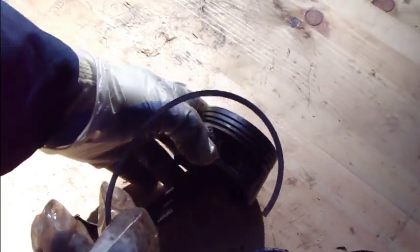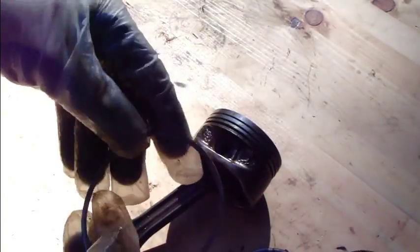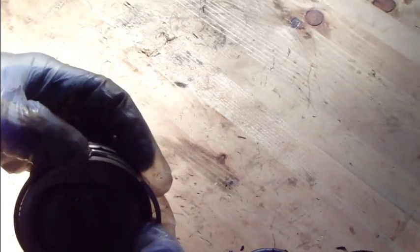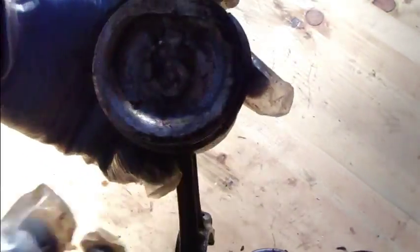In this Volkswagen, it's interesting that the first ring can flex somewhat, but if the piston ring gets into that kind of situation where we have bent it too far in this way, then it is scrap. We cannot install a damaged piston ring like this back, because then our engine is quite surely damaged.